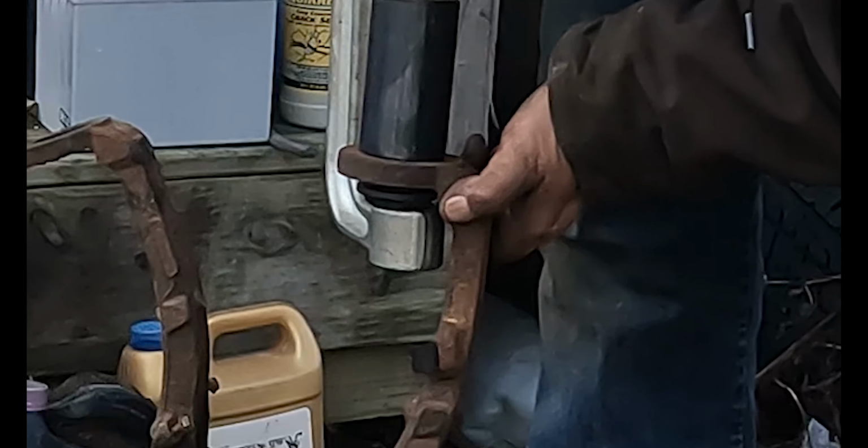Okay, we're getting this back together now. So we have this nut down here. Lower ball joint, 79 foot-pounds. This one here, upper ball joint, 96 foot-pounds. These bolts back in here for the upper control arm, 108 foot-pounds. The wheel axle, once it's down on the wheel, we can get that torqued to 103 foot-pounds.